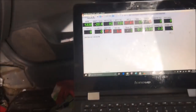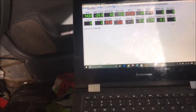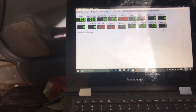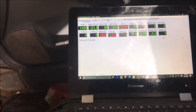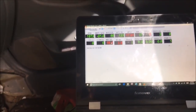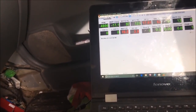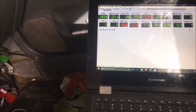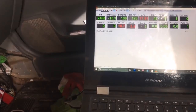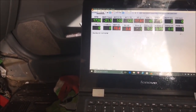I can already feel that the clutch has a strange noise — could be an input shaft bearing. And the alternator — holy cow, we are overcharging so bad. Whoa, look at that guys, 18-19 volts! That's how you cook a battery. When you smell one boiling, that's what's going on.